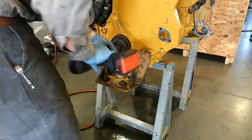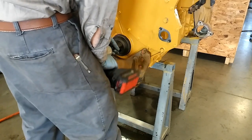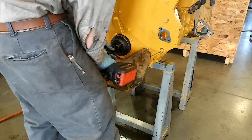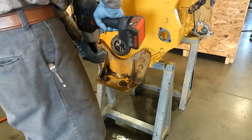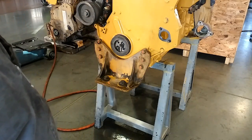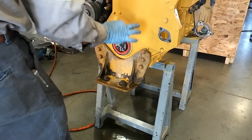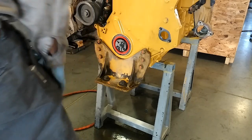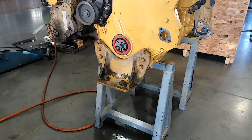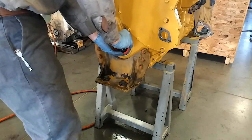We are installing our new main seal. Notice I didn't put any retaining compound or anything on that seal — that's what 'install dry' means; you just use the dry sealant that's already on the seal. When the installer stops, you are done — it will seat and the new seal is installed. Remove your installer. There will be a little film left by the dry sealant. If you're not going to be putting your dampener on for a while, leave the plastic ring in, because it helps keep the lip seal in its proper location and will keep it from distorting.